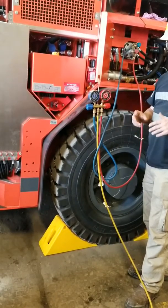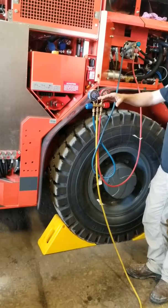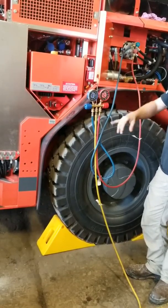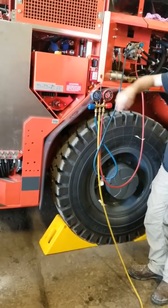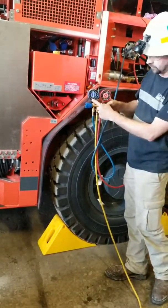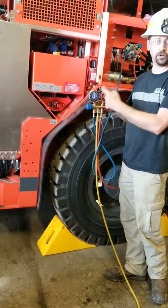You need to let that vacuum pump run with both valves open for like 30 minutes. Even if it's already stopped as far as it will go, keep that vacuum running — because any moisture that's in there, it's going to turn to gas and suck it out and dry it. Now after your 30 minutes of vacuum, you shut both of these valves, you let it sit for 15-20 minutes, and it should stay. It should not bleed out. If as soon as you shut the vacuum pump it just goes to zero, that tells you your system has a leak. You need to find that.